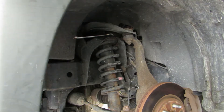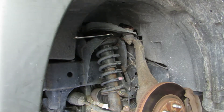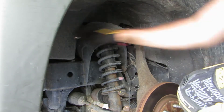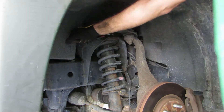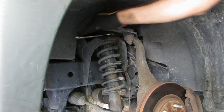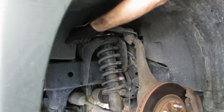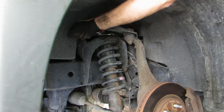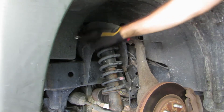Let me show you the blowtorch technique. See how stuck these little 14 millimeter bolts are — I got this one right here. I sprayed it a couple times over the last couple days with WD-40. I know that's not the best penetrating oil, but alright. This is lefty-loosey, should be pulling towards me. It's gonna be stuck on there pretty good. I can't budge this thing.